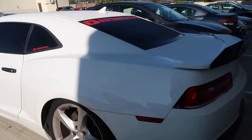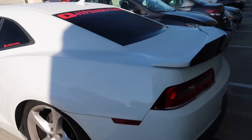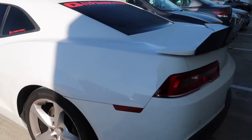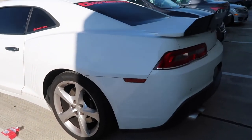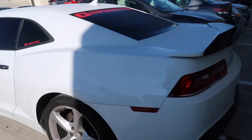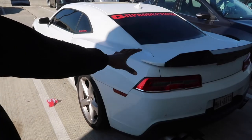Now for the rears, I'm gonna go ahead and raise the rear end all the way up, because what you're gonna be doing is literally reaching underneath the bumper, past the fender liner, and popping out that same tab that we did on the front end to get this side marker to come out. So give me 1 second. Don't mind the compressor.